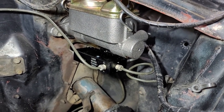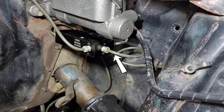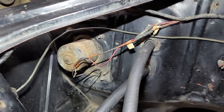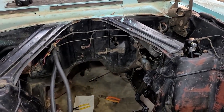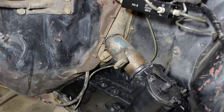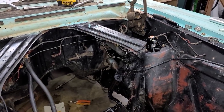So the next thing I'm going to do is install the new master cylinder to get a rough idea of where the lines are going to go into the distribution block — proportioning valve, whichever you wish to call it. From there I'm going to start bending along the firewall and down here. Cleaning it up, and hopefully soon there will be an engine where I'm standing. Got the master cylinder and all the lines routed. The one at the back is going down to the rear, the one to the front of the master cylinder is going to the left front, and then the other one is going against the firewall and then going to the right. Much better than what it was.